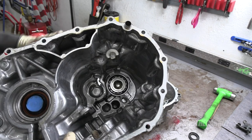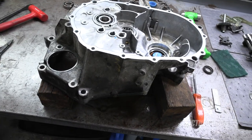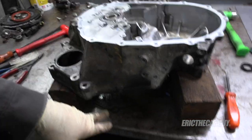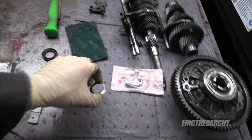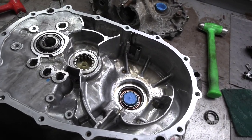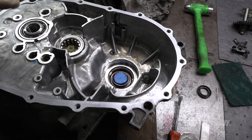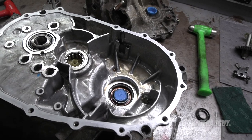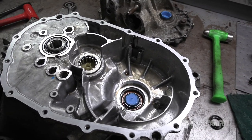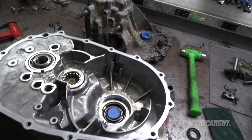I've reinstalled the 4x4s underneath because when you put the input shaft in, it sticks out just past the front of the case, making it hard to go together otherwise. Before you get too far, do not forget your shims — those need to go in there. I'm going to use Honda Bond to seal this up. Honda Bond doesn't like oil and it likes to fully cure. I recommend once you've reassembled the case, let it sit overnight and it'll never leak. I've done it within hours and been okay, but if you really want it to seal, don't put oil in it until the next day if you can help it.